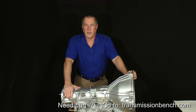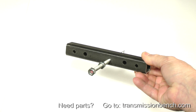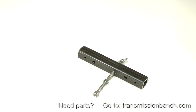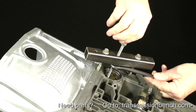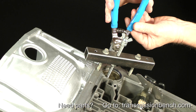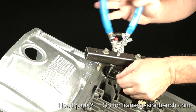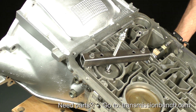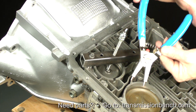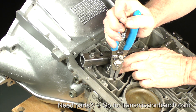There are two unique tools we'll need and I'll show you how to make them from common materials in later videos. The first is simply a length of steel with holes through it, along with a short section of threaded rod and nuts. It's used during teardown and reassembly to depress the 1-2 accumulator cover and the overdrive servo piston to make snap ring removal and replacement easier. I'll give you the dimensions for making this tool later.